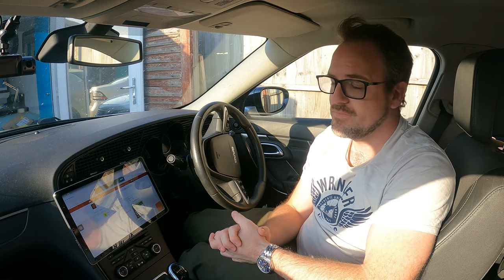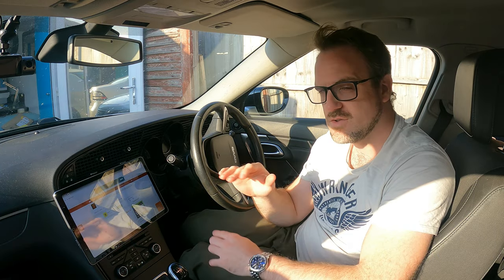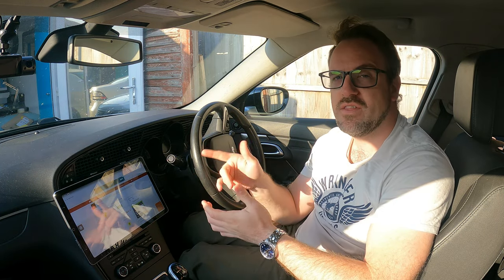Let's talk about how to install Netflix on your Android head unit. You can't find it in the Play Store because Netflix has chosen not to support any unknown Android devices, and essentially that's what the Android head units are. So you need to sideload it. Look in the video description and you will find a link to the Netflix version APK that you need — that's the installation file for Netflix.